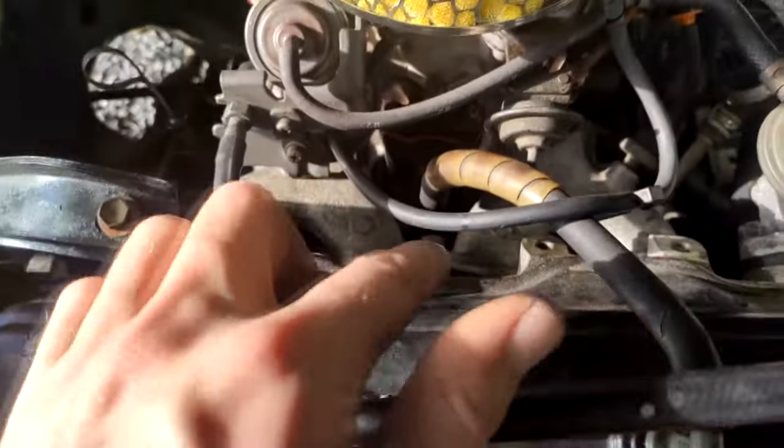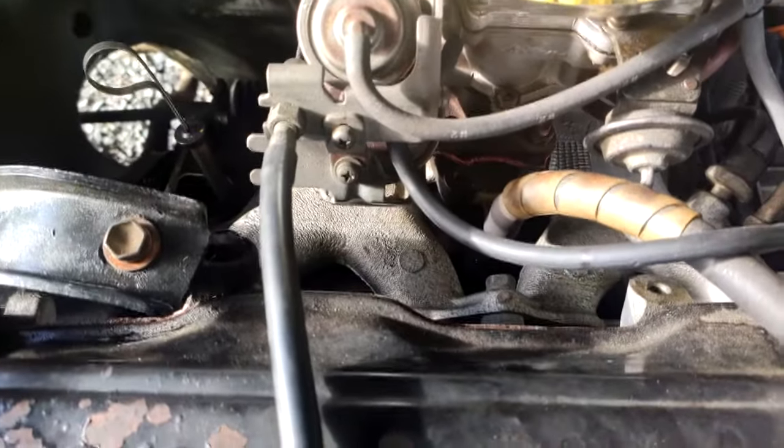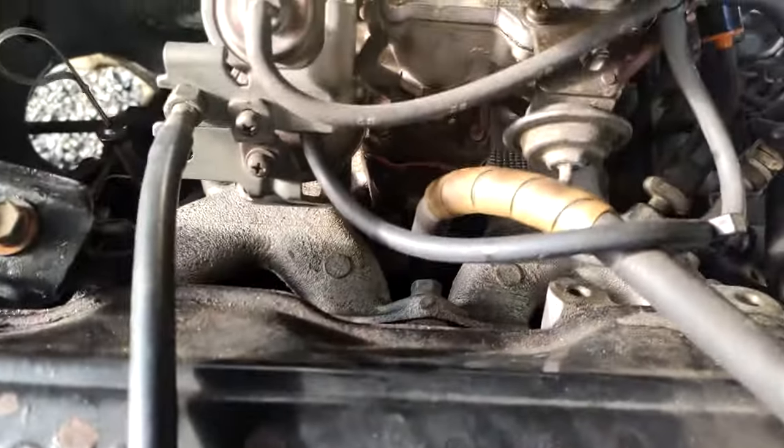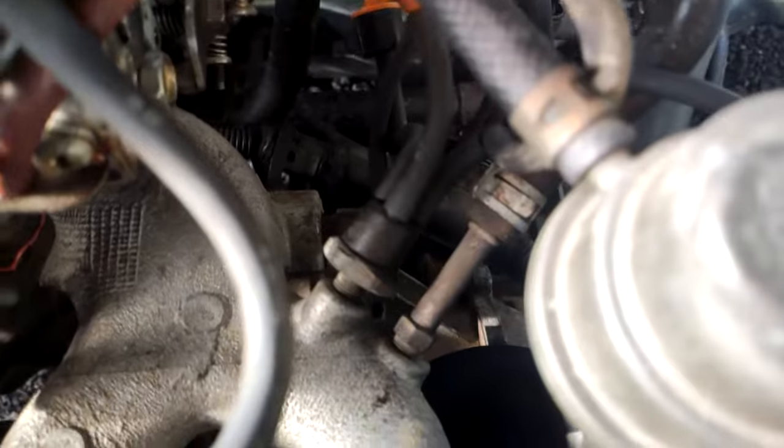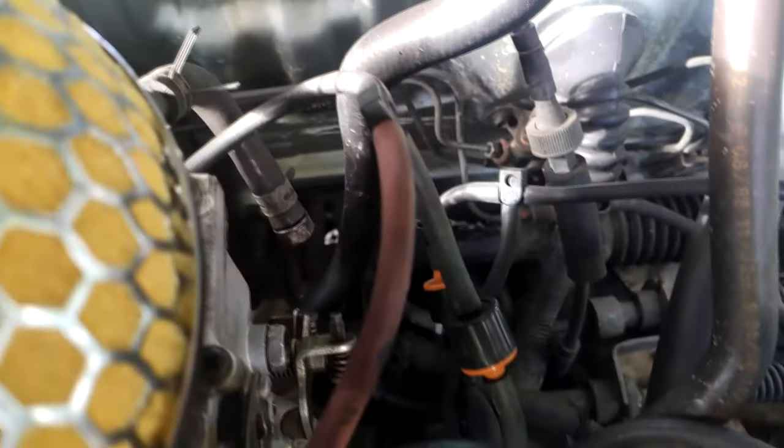What I've done here is there was originally a vacuum rail that ran along into here and I've now deleted that. So it hasn't got any of the vacuum rail and I'm just running factory hard lines with T's into everything. I've got this running into here, then that's teed off and it comes down into this main piece beside the brake booster. And then I've got all my lines teed off onto these, with those two T's teed off in there as well.